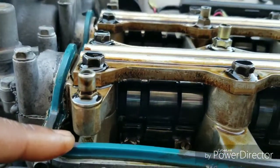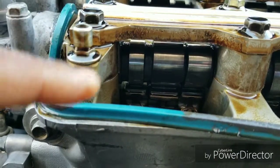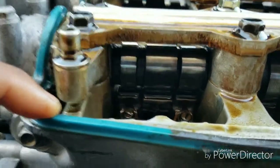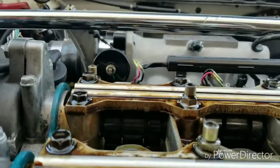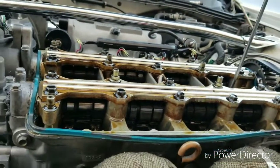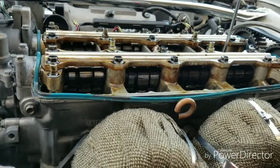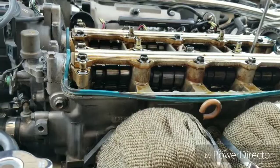So now you're going to adjust cylinder number 4. Same thing. You want 8 in the front, and you want it to where you're not able to get a 9 in at all. In the rear, you want 7, and you want to make it to where you can't get an 8 in. Obviously the next cylinder is going to be cylinder number 2, because we already did 1, 3, this is 4, and then it's going to go to 2. So let me adjust cylinder number 4.